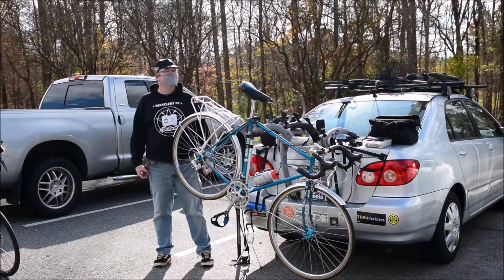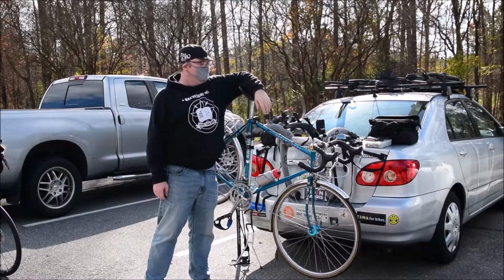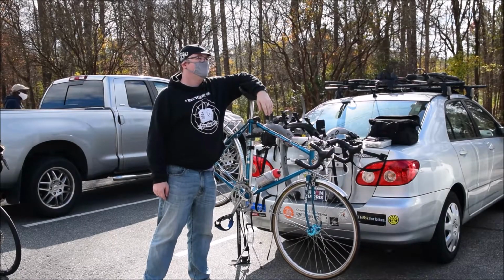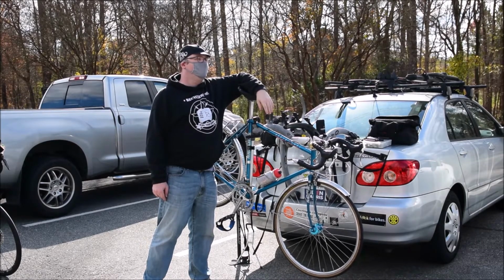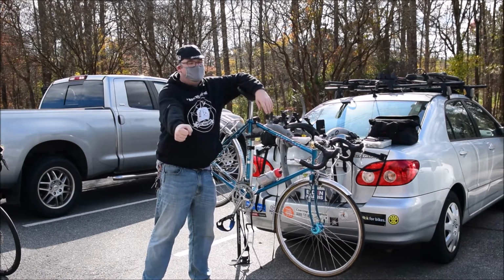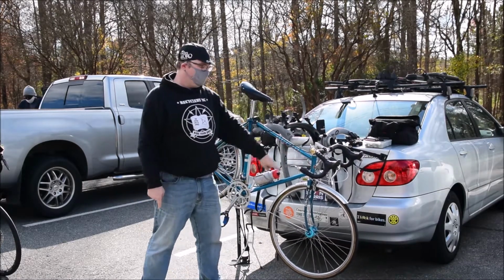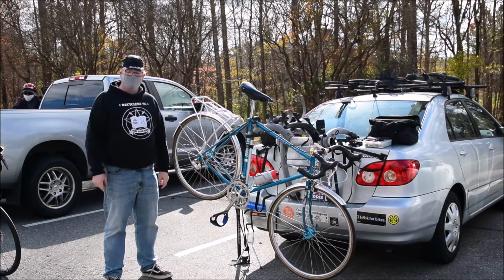You talked about bearings and rust and combining those two together. When you're cleaning your bike, is there any one part of the bike that you don't put water on because of the rust, the water getting in contact with it? Never use high pressure. Never spray with a hose. You want to drip or soak with a hose, but you never want to spray it. Especially around here and around here. That's your headset, that's your bottom bracket. Those are still cartridges in a lot of cases, especially with the newer bikes.